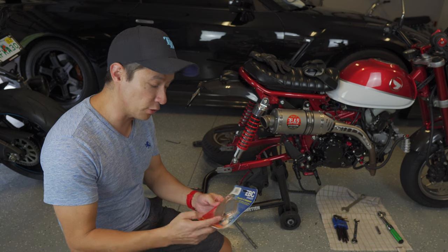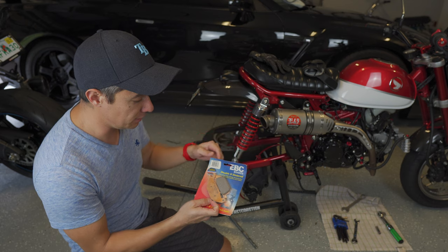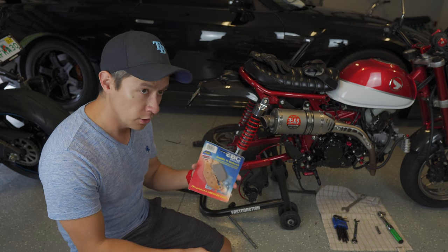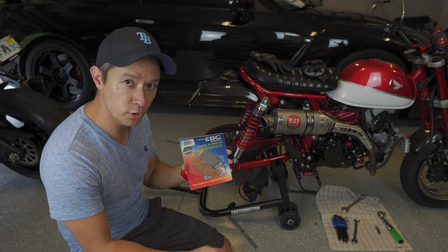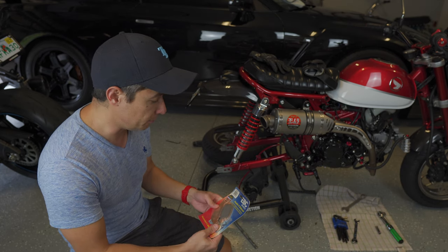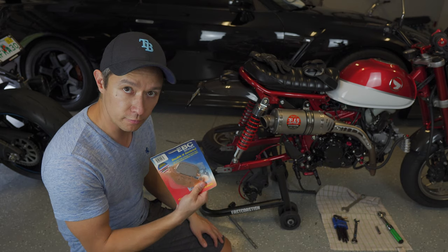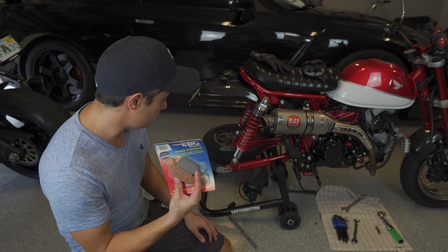It's been a few days, but I now have the correct rear brake pad for the 2019 Honda Monkey. It's from EBC — the FA343HH. I'll put all of the correct parts in the description below. It turns out the Honda Monkey uses the same rear brake as the Honda CBR125R — a bike that wasn't sold in the United States but probably in Asia and other places. So the front brake pad and disc are the same as the Grom, the rear disc is the same as the Grom, but the rear pads are off of the CBR125. Make note of that if you're doing the rear brake pad change.